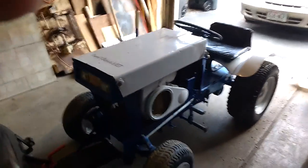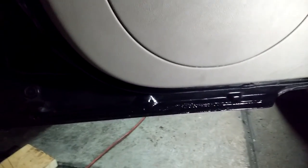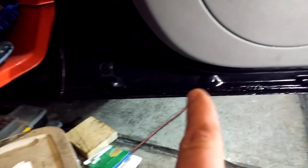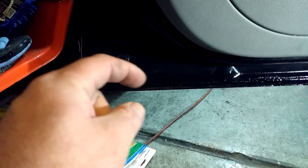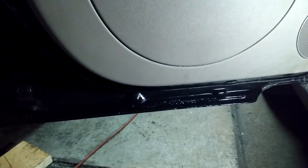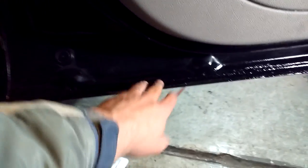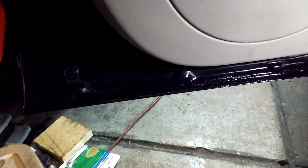Okay, that's it for this week — later. Update: I finished it — the rust is basically gone. I sanded it down and applied a rust converter because there's a lip there where I couldn't be sure I got it all. It took several hours but it's good and dry now, matches the rest of the door. You don't even notice it. I just wanted to keep the rust at bay — that'll do it. It's been a long day — later.